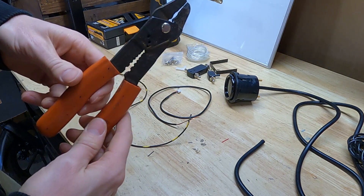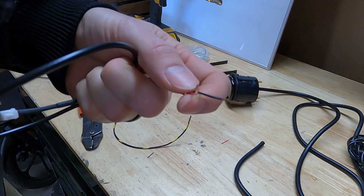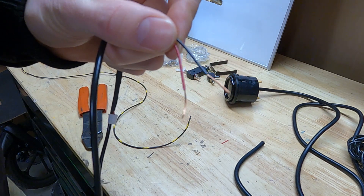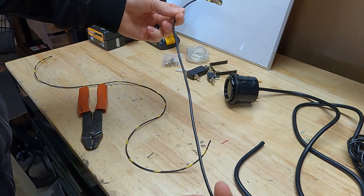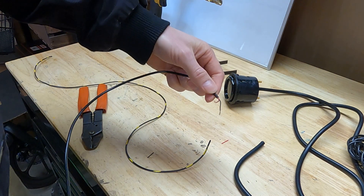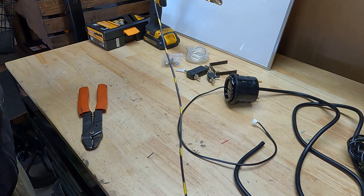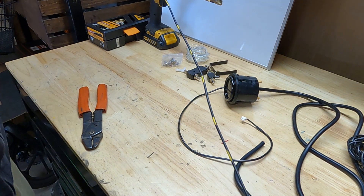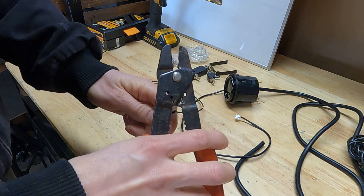I might put a piece of tape labeled 'power' on it as well so I can identify it when diagnosing issues later. If you don't have a wire stripping tool, it's very handy and important for any vehicle wiring. I already have the wires prepped that plug into the back of the gauge. The stock leads are only about 20 inches — I need a lot longer, so I added about two more feet of wire, spliced together using butt connectors.